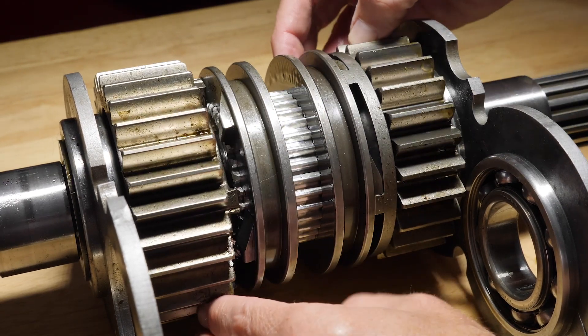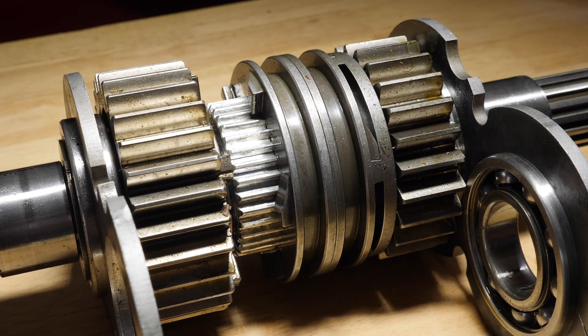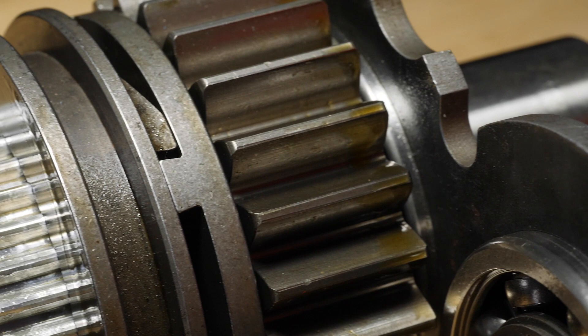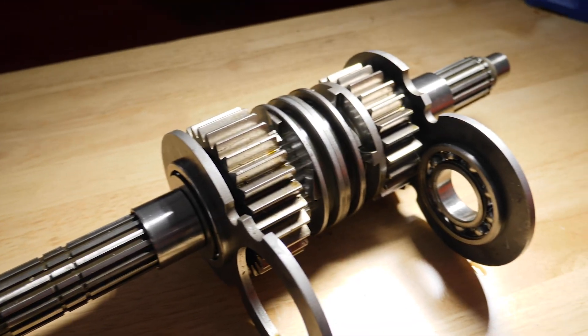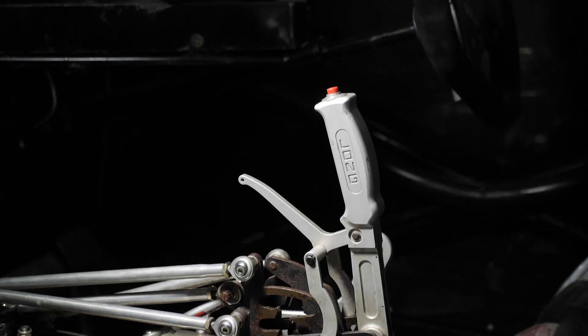As soon as the dogs engage in second gear, this changes the speed of the gear set and then the dogs in first gear will be driven out. This hits the back cut and then pops the rest of the selector out of first gear. Your advantage here of course is seamless shifting and a seamless change in gear with no interruption to the engine power.